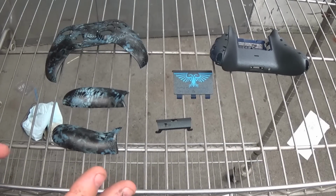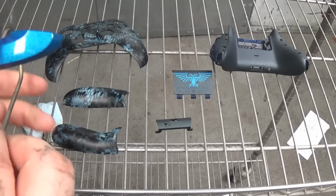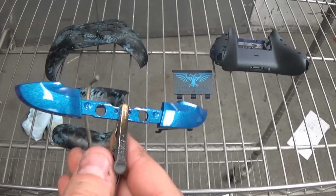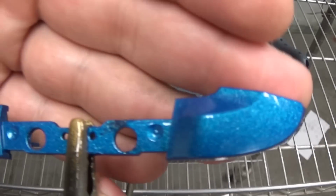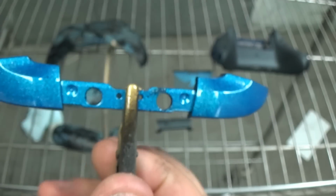Alright, so we are the next day. We gave everything a day to dry and cure. We're in the clean room right now because yesterday at the end of the day, we gloss coated with what we call 2K. It's a very glossy part A, part B, automotive grade clear on all of the stuff that we did our metallic blue with, and I think it came out great. Really good accent pieces for what we're doing.